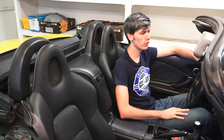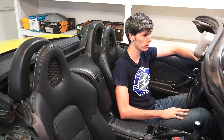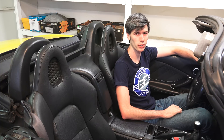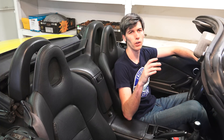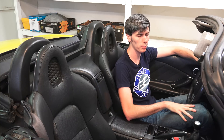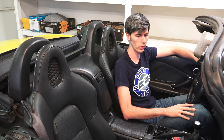So that pretty much covers it. The car is in pretty good shape considering it's 14 years old — just a couple of fluids to change out, that timing chain tensioner, and there is a little bit of rust on the rear lower control arms in the back which I may replace over time. It's nothing too bad, so it's not urgent.